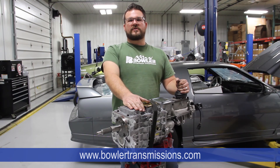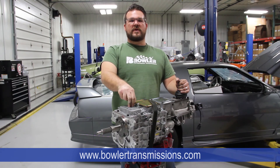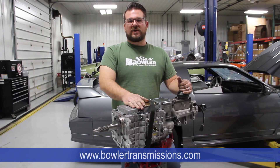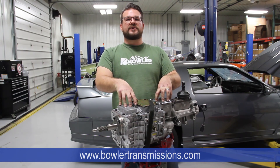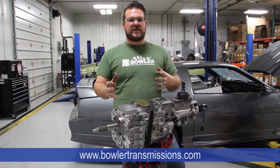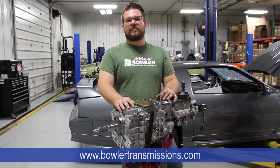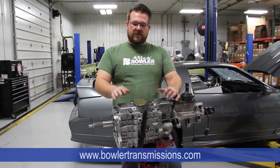Now that all of our tolerances are within spec — we've checked flywheel runout, checked the bell housing for parallel to the block, and checked the concentric circle on the bell housing opening for the transmission to slide in and fit properly — all of these things are obviously much easier to do with an engine out of the car. But in a lot of cases we're doing these transplants while the engine's still in a running, driving car, so doing it up under the car gives you a better idea of how to perform some of these procedures. Doing it outside the car gives you a lot more room and an easier area to work with, though it does require a different approach for mounting your dial indicator.